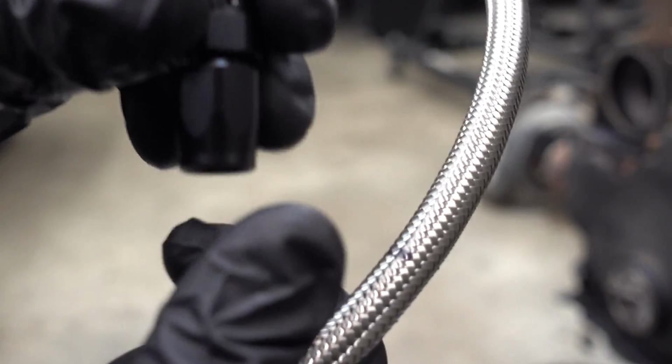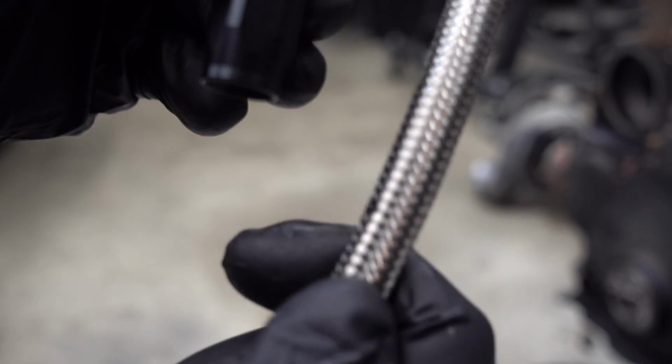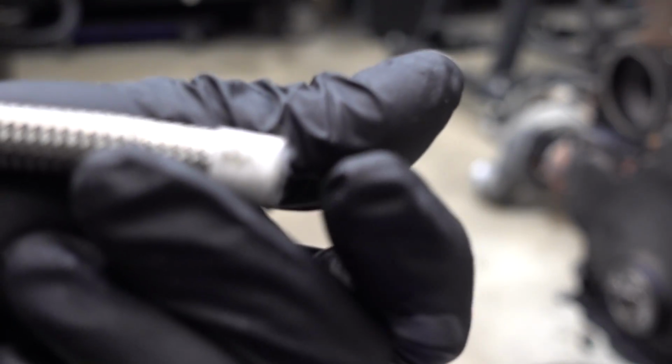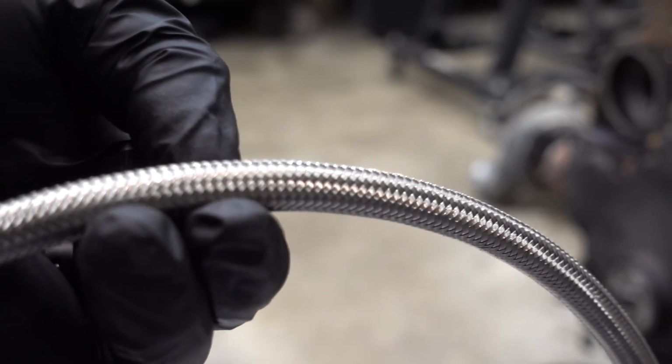See how this piece works: you want to line it up where it's going to be attached in here, and we know that it bottoms out right about here on this bottom piece. So I usually line up the mark halfway down that nut. That way you can see exactly where it's going to sit. Just like this end is taped up right here, we're going to wrap that with some good tape right in the middle of our mark, and then cut that with our cutoff saw.